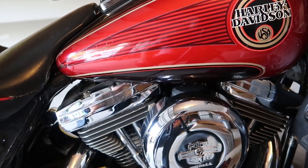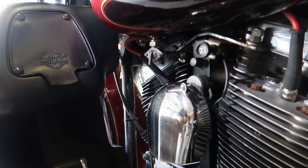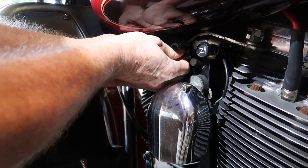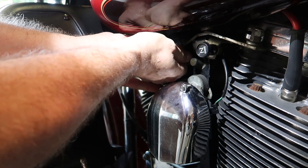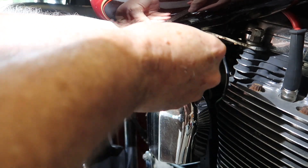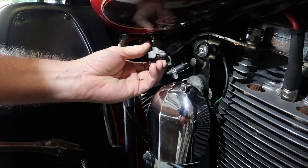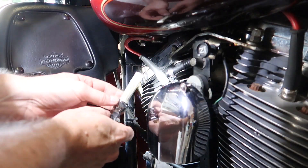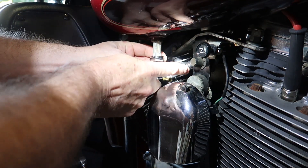I've had some great times and great memories with this motorcycle. I've changed the fuel lines and I decided that I needed to put in a new petcock as well. That's this part right here — it's kind of like the faucet of the gas tank. It allows the gas to go from the tank to the engine. It's 30 years old, so I'm just going to replace this one. It was really difficult to turn it off and on. It just goes right into the gas tank like this.